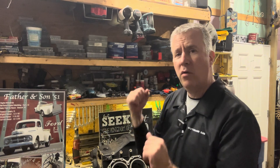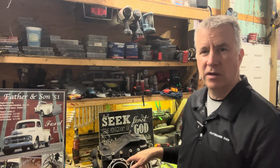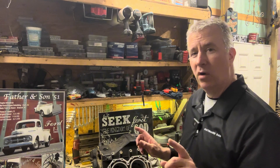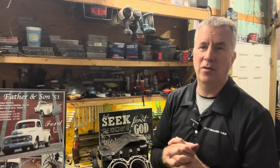But I want to check this side first — I just want to hone it lightly with the 100-grit and make sure there's no scratches, because sometimes you don't see them until you start to hone. I'm going to flip this block over, but first I'm going to take a little more out of these two cylinders, record it, and write it down to see how many thousandths I went over. I think I'm going to need to be at 10 to 12 thousandths. Our piston wall clearance on the other one was 5 thousandths, so if I'm at 12 thousandths that is 7 thousandths too big. A 10-over piston will probably do it — we'll have to see what Pro Marine has. It might have to go to 30, as sometimes that's the only size they have depending on the brand.